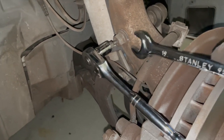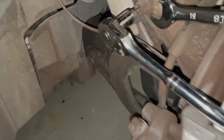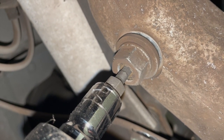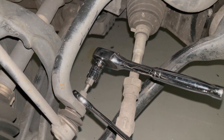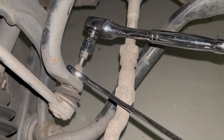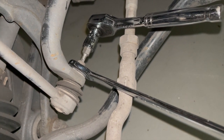I'm just going to quickly show you what I'm doing. I've got the socket set with the number five hex there in the end of the bolt and I'm just releasing this nut. I'm going to keep going with that one and then hit the other one behind the hub. Same thing for behind the hub — I have the number five hex in the end of the bolt, using that to hold the bolt steady while I unscrew the nut using my socket set. Then we will remove it and replace it with a new one.